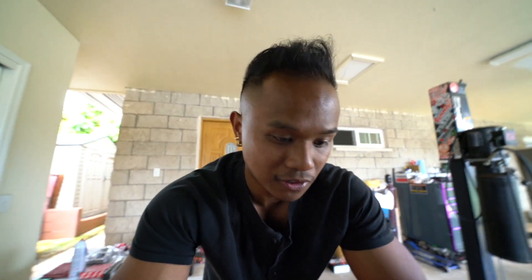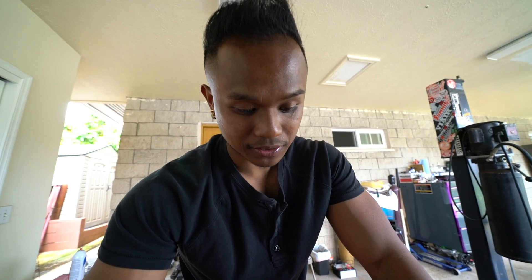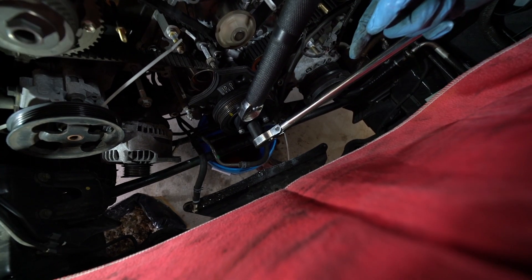We're going to move it to 50 degrees — that's what the information online says. There's a lot of information online so if you ever get stuck, you can always find something. Then we're going to remove the crank pulley and the timing belt, and slap the new one on. They didn't have the crank bolt in stock so I think I'm going to reuse this one — the book says to change it but I think it'll be fine. I'm going to use the tool for the cam to hold the crank while we crack the crank bolt.